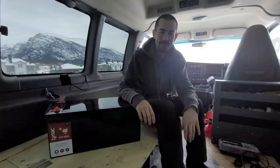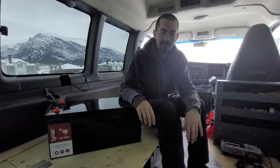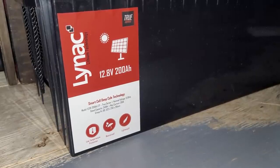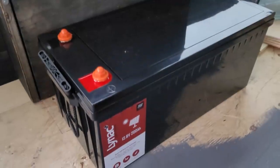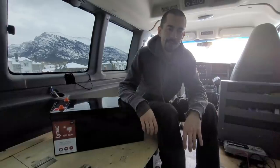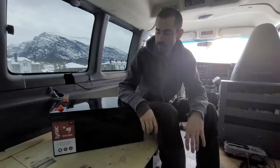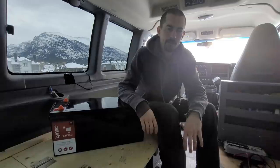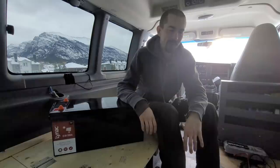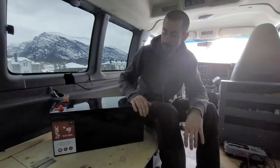This is awesome - I finally got a big piece of the puzzle. This is a lithium battery made by Lynac, a Canadian company based out of Thunder Bay. I had the same brand of battery in my minivan that I bought over a year ago - we kept in contact and Connor offered to donate a new lithium battery to my new van build, so thanks so much. This is their 200-amp-hour True Series model. There's actually 240 amp-hours in here, but 200 is what you can safely use, all protected by the BMS with a low-voltage cutoff and a low-temperature cutoff - really important in cold climates. The specs are great too: it'll do 200 amps continuous discharge, so I'll be able to run my 2,000-watt pure sine inverter to its full capacity. It just opens the door to all kinds of new possibilities.